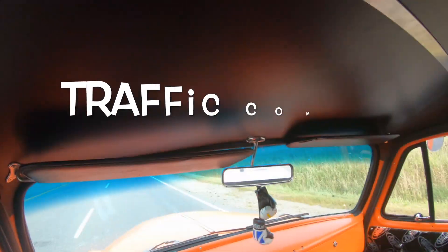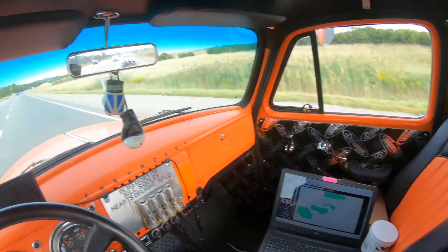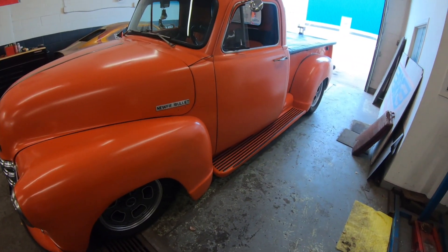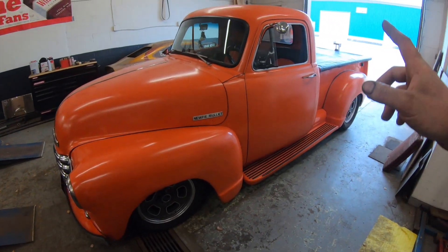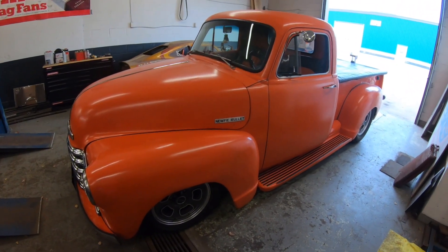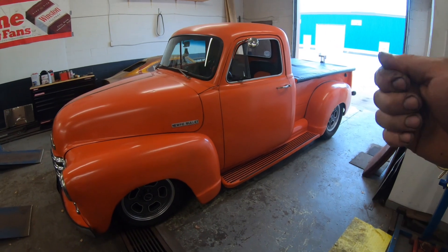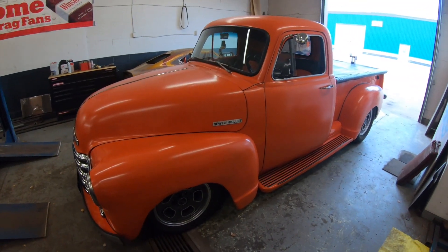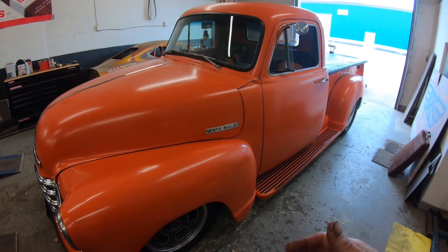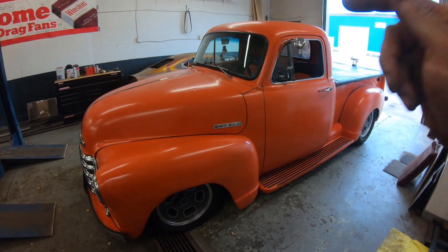She's running perfect now. Really, all it came down to was just the fuel map — had to go through and clean up the bottom of the map, because when it idled down it would come past that lean spot and just couldn't recover. That's why it was stalling at lights and stuff for him. I have to cold start it in the morning, but his cold start issue — same thing, sometimes he would start it up and then it would ramp down and just stall. That should all be taken care of. Number one, just get those fuel maps cleaned up. And if you don't have the know-how, see if you can find someone in your car club or maybe a local tuner who can take care of these issues for you. You've invested a lot of money into this Sniper unit — you've got to make sure you're getting the most of it.